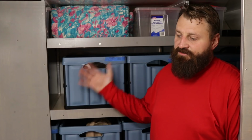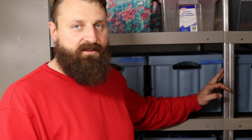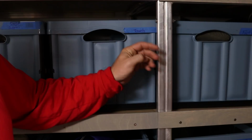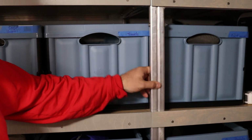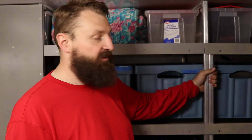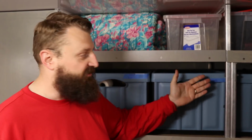And lastly, the shelving unit. I finished the shelving all the way across the back of the vehicle here. As most of you will know, our shelving and countertop and dinette, all the interior furniture and cabinetry stuff is all framed on 1-inch aluminum tubing, 1/8 inch wall tubing that I've TIG welded into box sections, and then those sections brought in, and anywhere it meets an exterior wall, composite panel, it's bonded to the panels, and then anywhere a box section meets another box section, it's all bolted together. So the result is all the cabinetry is super rigid, nothing creaks or moans and makes funny creaking sounds, and it's super strong.